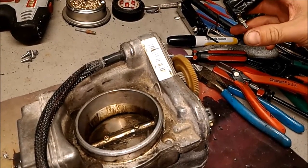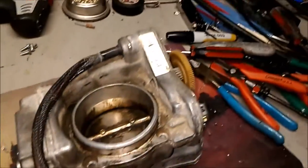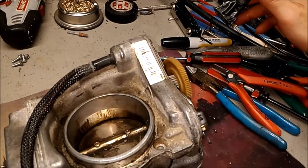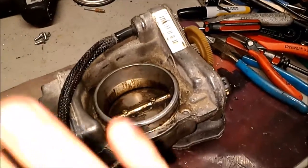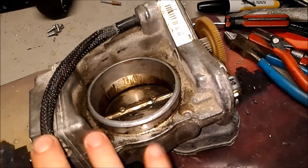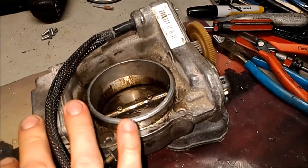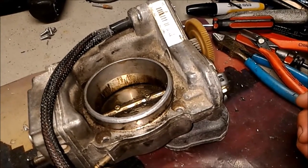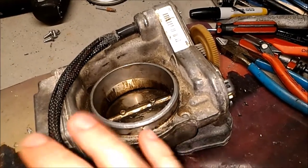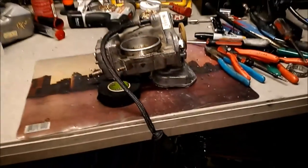It shuts right down. If I shut it down, bring the lever back to idle, put on the power — same exact thing. So definitely a problem here. I'm going to have to really — it's a very delicate area though. One wrong move and you're going to destroy the potentiometer. The throttle body becomes — well, it can't be repaired, but it's just way too expensive to replace. So right now it's a good base, I can work with this. I'll fix it.